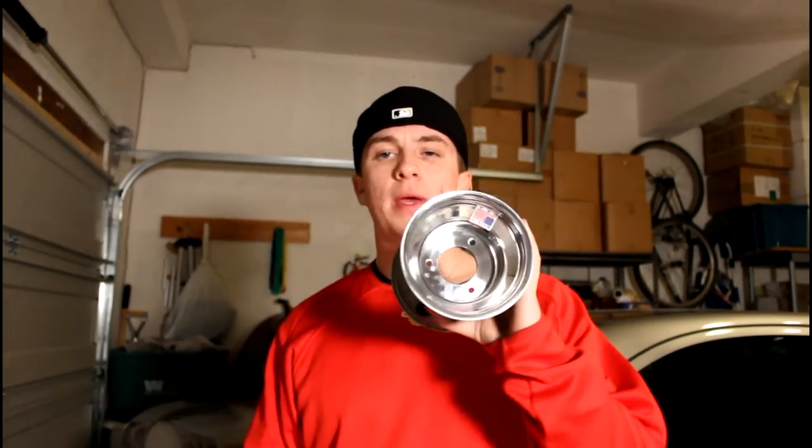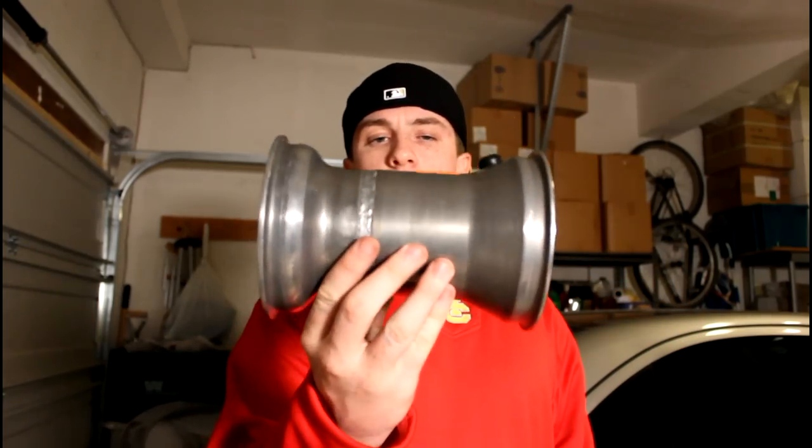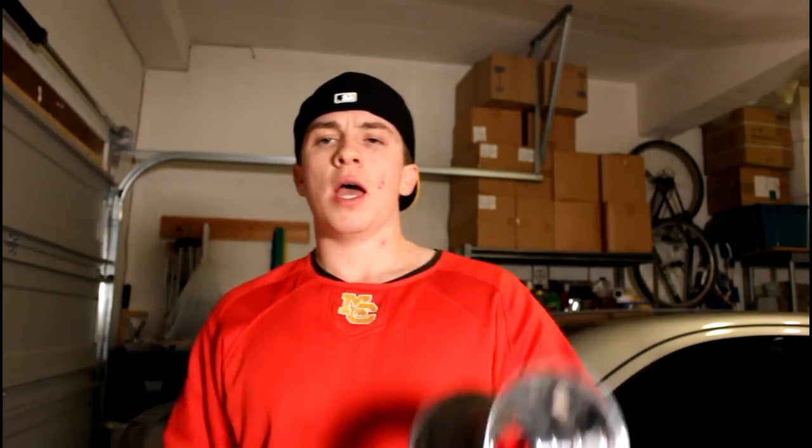The wheels are standard racing shifter cart wheels made of polished aluminum with a 3×2.5 inch bolt pattern, sourced from the same site as the tires. The rear wheels are wide to fit those fat tires. I tried finding used ones but wanted to ensure fitment, so I ordered all four from cometcartsales.com. At about $40 each, four wheels is a significant cost, but the deep offset on the rear wheels is going to give the cart a really cool racing look.